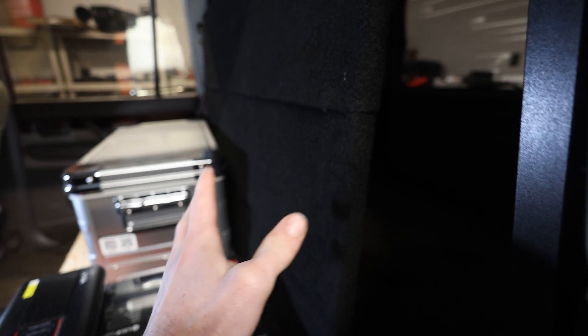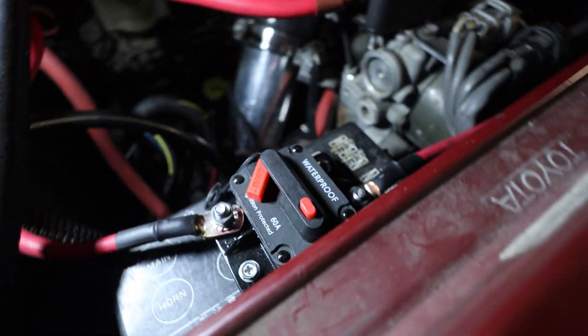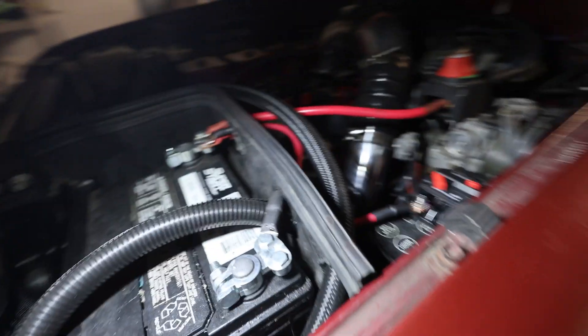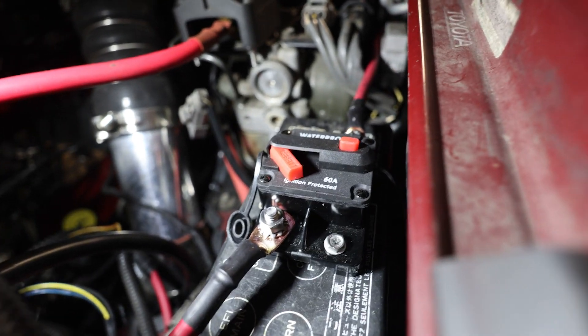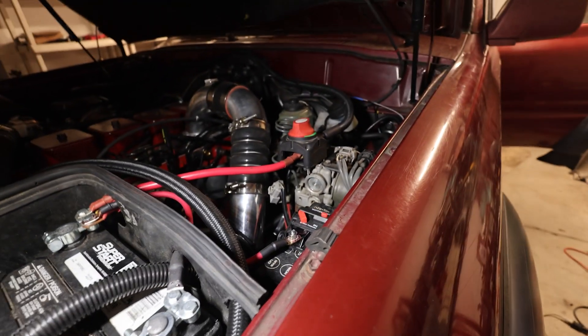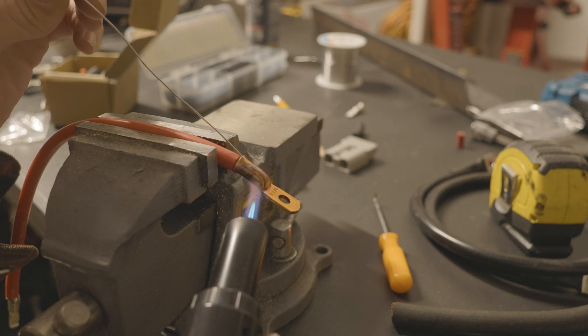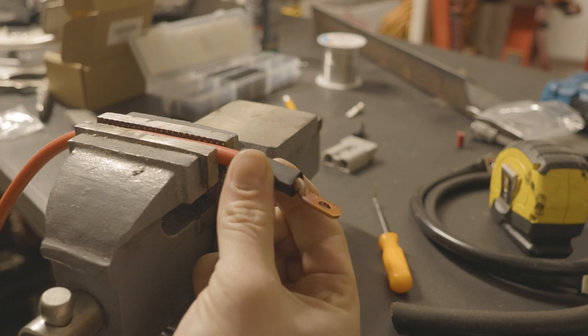I'm going to wait on some bus bars to arrive for the ground and power connections. I routed the wire really clean — pulling up all the seams and it's all nicely tucked. It's coming out through the firewall near the clutch master cylinder going into a 60 amp breaker, which I'll leave off because I don't want to send voltage to the back and cause voltage drop constantly. When I go on trips I'll go ahead and reset the breaker. They call for a 60 amp breaker so that's what we went with. For pretty much all the two and six gauge connections I'm using copper lugs and soldering them together with a butane torch — when you get the end hot it sucks through all the solder and makes a really good connection.